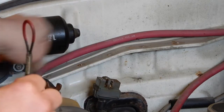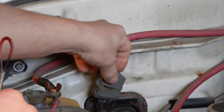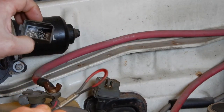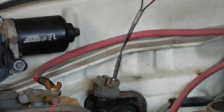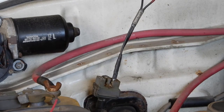So basically you just take this and you've got your diagnostic port back here. Take the cap off and we're going to jump from TE1 to E1 in here to read the codes. Stick that in there, and that one in there, in place of where we'd use a paper clip. Let me cruise you around to the other side and we'll come back and I'll show you how to actually read the codes.